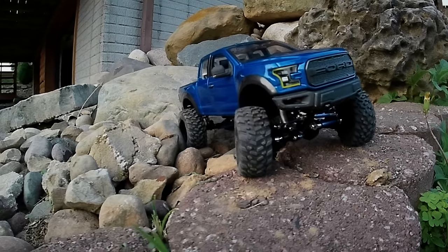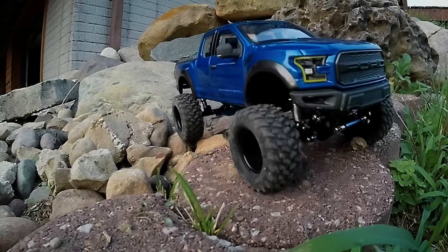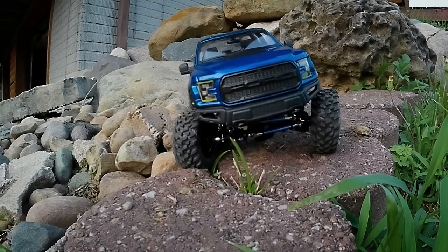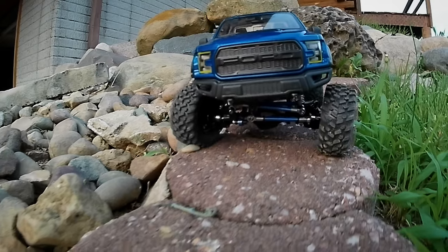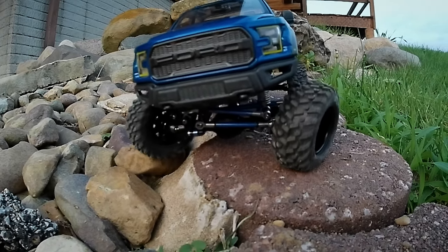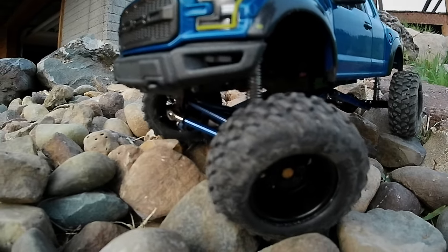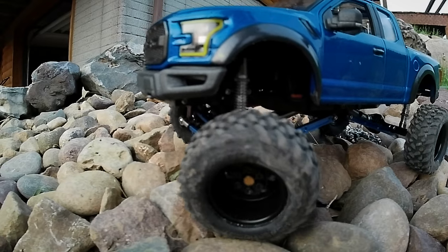I spent a crazy amount of time working on the suspension — probably a solid two days getting everything dialed in. I took the factory shocks off and decided to run telescoping shocks I had kicking around. Up front, the panhard and the drag link are both now attached on the same side. From the factory the panhard was on the other side, making an X up front, which completely limited how the front suspension worked. Switching the mount fixed everything — no more unnecessary body roll or suspension binding when it turns.